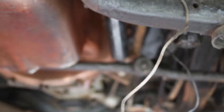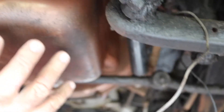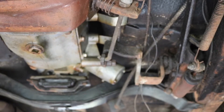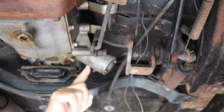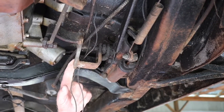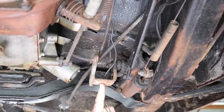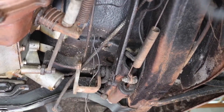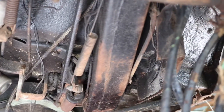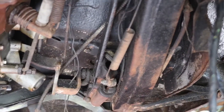This is the flathead oil pan, and back here is the flathead three-speed, and it has an electric overdrive in it. I'm not real familiar with them — I don't know exactly how they work, but that's the overdrive. Something that's kind of unique: this is the brake master cylinder and this is the clutch z-bar right here. It hooks up here and goes through the master cylinder over to the clutch pedal — really weird how it goes through there, a lot of engineering went on there.